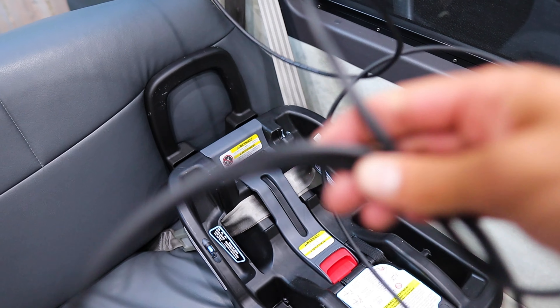On the Pleasure Way, there's a back valance. If you reach your hand right over the top underneath the screen shade, you can feel just a little bit of a gap between the suede wall and the wood cabinetry — that's where I ran the cord down. The first time I ran it, I came right underneath the zipper on the back screen, then realized if I do that I won't be able to zip shut the screen. So I felt around the top of the screen — there's Velcro at the very top — pull the Velcro down and you can run the wire right above the Velcro on the side of the valance.